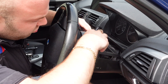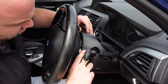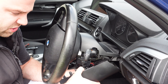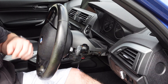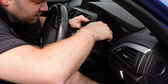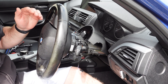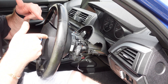You can use a flat head screwdriver — be careful because you don't want to crack the plastic. If you lock the steering wheel up and remove the cowling here, be careful because you've also got the transponder which sits down here. Pull that out and that's the bottom bit of the cowling out. Once that's out, you can then lift up this upper portion. I'm going to show you how to get to the steering wheel clips — this is the easiest way to remove the steering wheel.